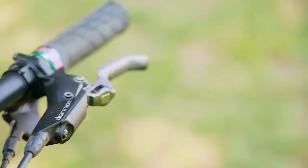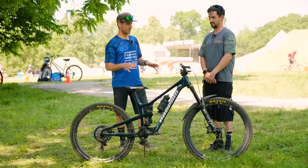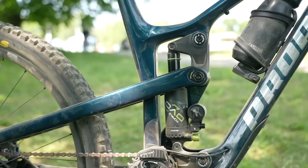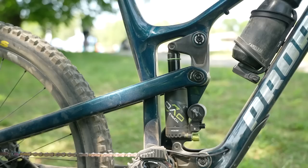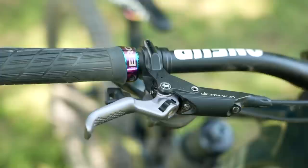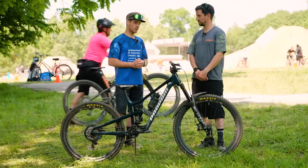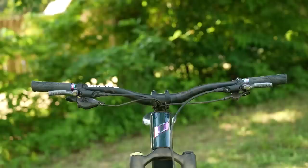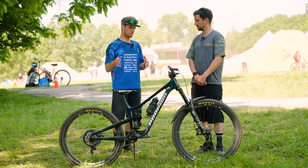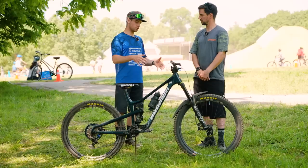It's got crazy powerful brakes. I've done a bike check with Jorian Burrel in the past — there's something about you guys that like your levers quite flat on the bar. Is that because you ride steep trails? Yes — it's set up for more steep and more narrow terrain. For me, it started with struggling with arm pump. The first thing you want to do when you struggle with arm pump or wrist pain is to play with suspension settings, tire pressure, but most importantly cockpit brake setup. I've played around with every single setup you can think of, and this is what works best for me. It allows me to keep my elbows out, relax more — I don't have to hold the bar nearly as much. It performs best when it's steep and gnarly. On flatter terrain, that puts you in a position that might not be optimal, but that's not really where I want my riding to shine. I want it to be as best as possible when you get super steep and gnarly, so this setup works really well for me.